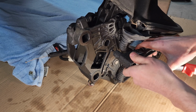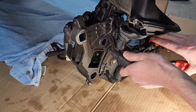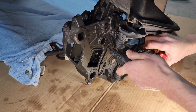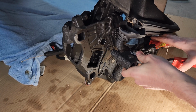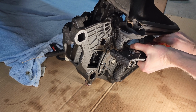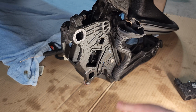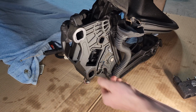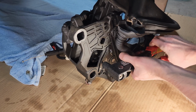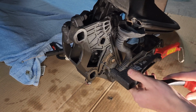Push our rivet tool in, applying a little bit of pressure to make sure everything is going to be seated properly, which it should anyways when the rivet compresses. Give it our initial squeeze, reset, and this is the one where it should break the rod off. There we go. We've got our rod right here, and this one is in. And now since this one's already installed, let's slide it on. There we go. And give it another pump.